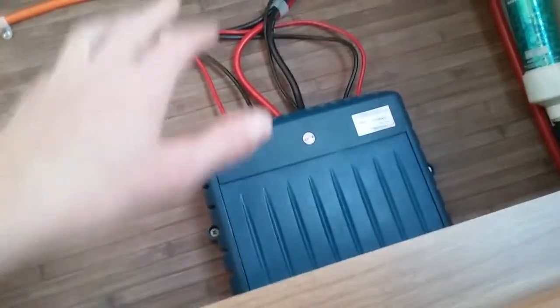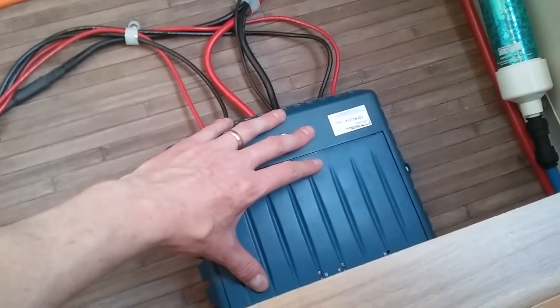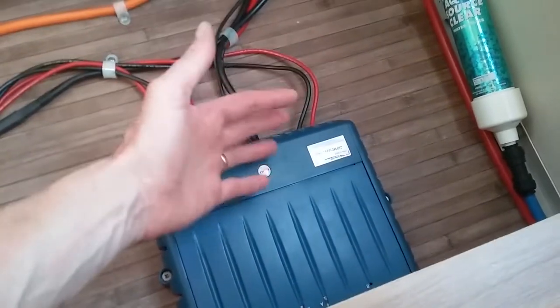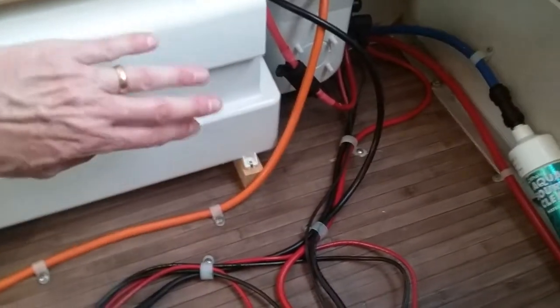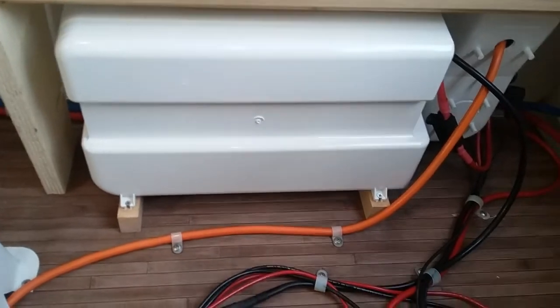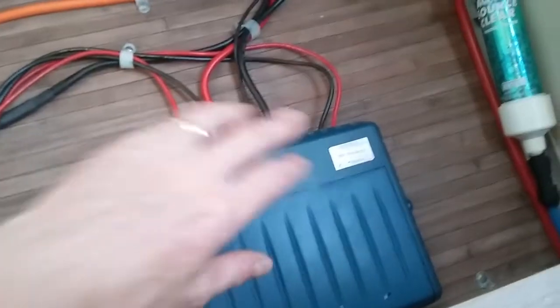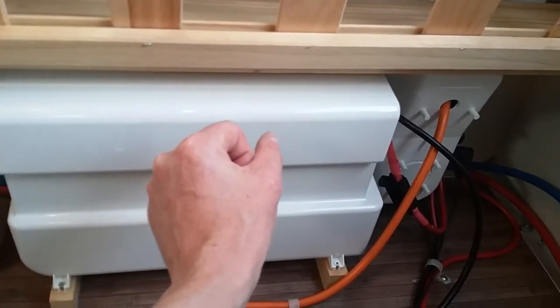Before doing this though, the main reasons why the hand controller will not sync up to the control board are if the leisure battery is too low, if the battery in the handset itself is too low, or if you've turned on the isolator switch located in the battery box just here and got distracted, because after a while of inactivity the control board will turn itself off automatically. So you will need to go back to the isolator key, turn it off and turn it back on again.